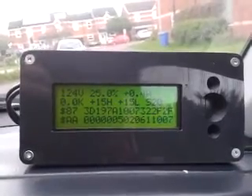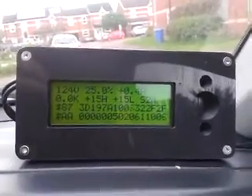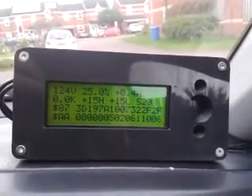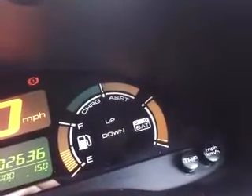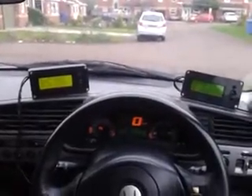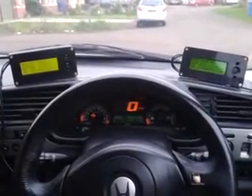What I want it to do when it gets down to below about 150 volts is to start regenning on its own without being commanded, so it tries to keep the capacitors up to a fairly high level. The state of charge gauge has gone down to one bar, which is what I've got it set to when the caps are exhausted, but I still haven't got that working correctly. That'll be a fairly minor software change. So that's where we are — there are the two gauges on the dashboard. I'll upload this and hopefully make some progress later today. Thanks for watching.